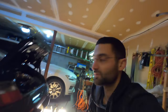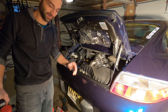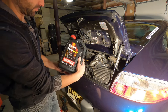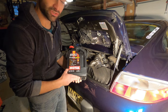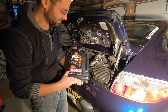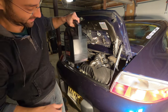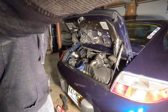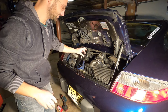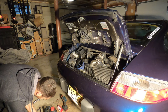All situated and cleaned up — now we'll come up top here and fill up the oil. Our 911 is a 3.4-liter, and the 3.6-liter uses a 5W40, which is what I use in this car based on the previous owner. We're going to use 8.75 quarts of oil, which means we want 1.25 quarts left when we are finished. Put a little rag here to catch any drips — let's do it.